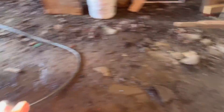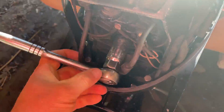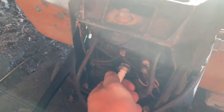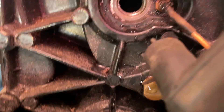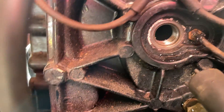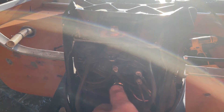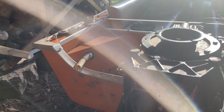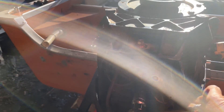After doing a little bit of research, I'm going to take the plug out and see if there are any cracks around by the spark plug — which I doubt there will be. Looking very closely, I see zero cracks around there. So here's what's probably happening: it's a gasket. It's going to need a water cover gasket. This whole cover holds the spark plugs and various things, but we need to replace that gasket. This is going to be interesting because it's way down in there, but we'll see if we can fix that.